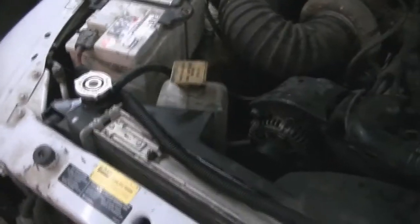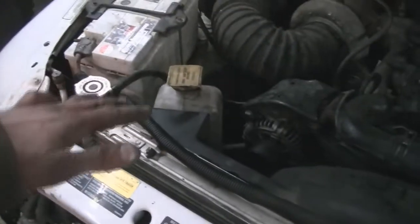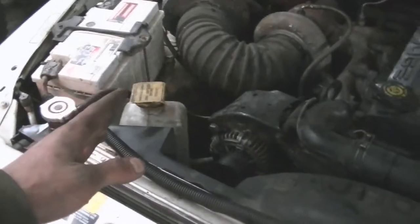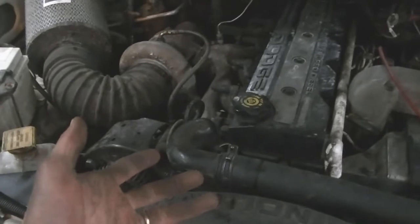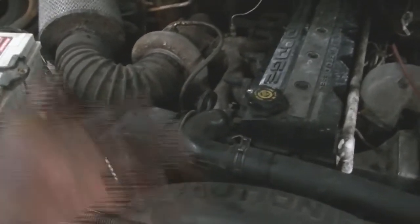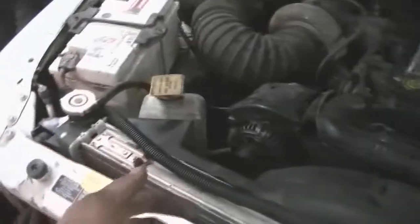For now I had to bypass it — it's cold but it works. The last test drive went pretty well. 90 degrees is the middle on my gauge, which is when the thermostat's supposed to open. It got up to 88 and then started dropping, so it probably opened the thermostat and cycled all the pepper and coolant through.